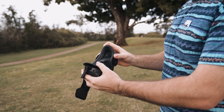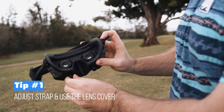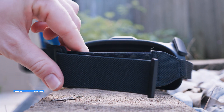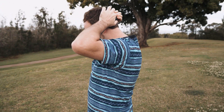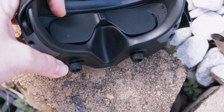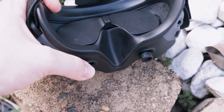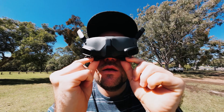Tip one is about the DJI Goggles 2. Take the time to adjust the strap and slide and twist the knobs underneath to get the right focal point, because you can damage your eyes if it's not in focus. The main tip here is to use the lens cover — it prevents the knobs from accidentally sliding or twisting, so you don't have to re-adjust the focus every time before you fly.